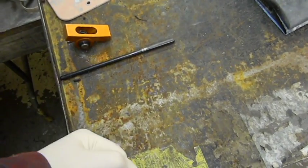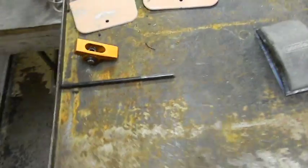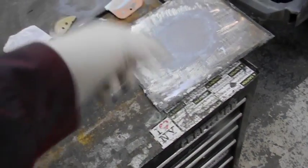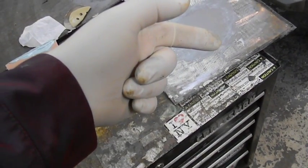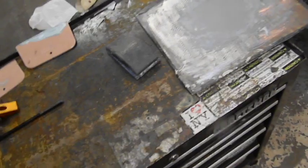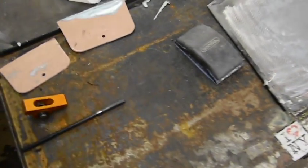And the rest of the stuff, I don't have to tell you how to do it. You know how to take stuff off and clean it. Just get yourself a bag that you could put on that motor every single night and cinch it down on the other end, even if you use a bungee cord or something. Keep constantly spraying anywhere that's internal to the motor with WD-40 and keep closing it. Even if you get it on the outside of the motor, it doesn't matter. We can clean it off later when we paint it.